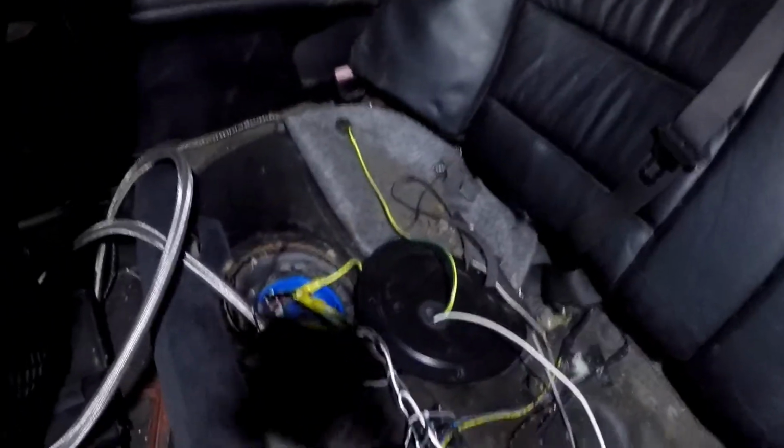So it's backwards, but at least you have a gas gauge. For the E36, a lot of people do super complicated things, like they pass voltage through and then get readout screens and figure out the voltages for different fuel levels so that they get percentage readouts. I don't care that much, so this was kind of an easy way to do it. Then I'm also running a dedicated power and relay for the pump, because you have to have good power going to your fuel pump. And yeah, that is what's going on here.